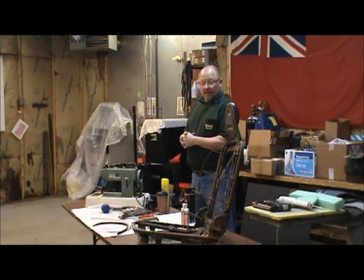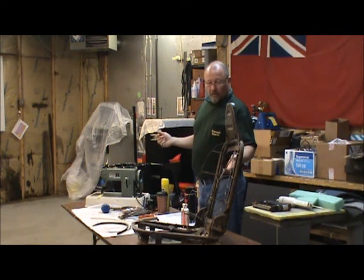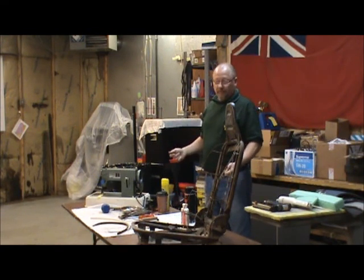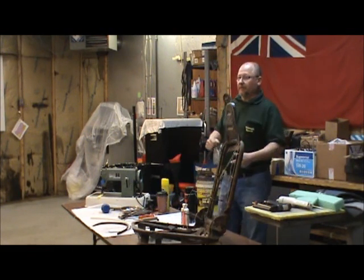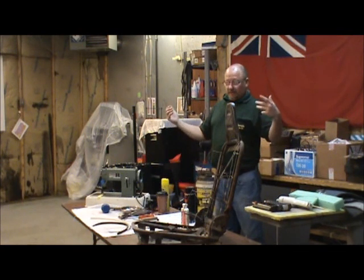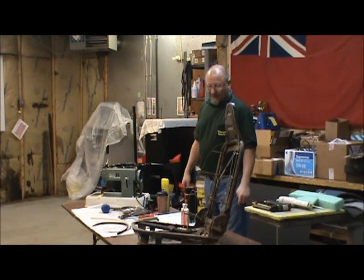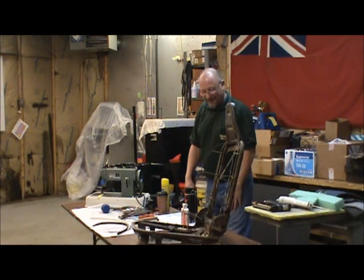Yeah, right. We get a lot of seat frames that come in, and they're broken. They're cracked off. The welds are broken. We have to get in and straighten them out, because they're just going to want to twist. And the seats do go through quite a bit of torque. When you get in and out, you push on it. You plop down, and if you weigh a couple of pounds like myself, there's a lot of weight that this is holding. But this is just a rust bucket of an example here. Hopefully none of your seats look like this underneath, because otherwise, holy cow, we'll be seeing you real soon.